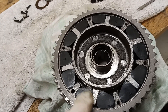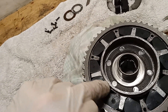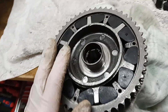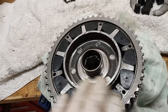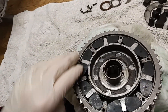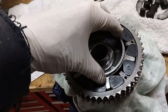The orientation is: the long back goes to the spider, the short nose to the chain wheel, and the long flat at the bottom. I did start to put one in the wrong way, but it's obvious the long flat goes to the chain wheel. Now I need to make sure the rubbers are all fully home and that the spider is fully seated down in the chain wheel, because we're about to put the outer cover on, and it's very important the spider and rubbers aren't protruding higher than they should be.